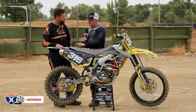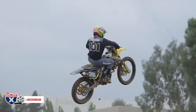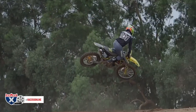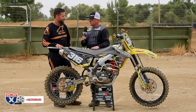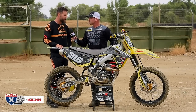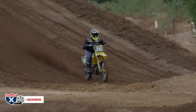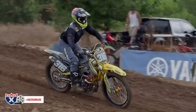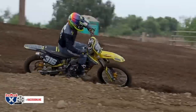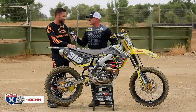Your options are to buy something a little older like this and put money into it to fix it, or take a gamble buying somebody's used bike that you don't know how it's been taken care of. So this way you know it was done right. Right, because I had it since the beginning. When I bought it from Sebastien, it only had about 30 hours on it. I don't ride it hard, and I change the oil and air filter frequently. When we took the bike apart at 120 hours, it still looked pretty good. So I knew how the bike was inside, so I just rebuilt it and there were no surprises for me.